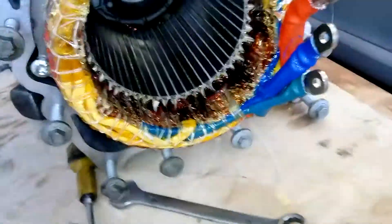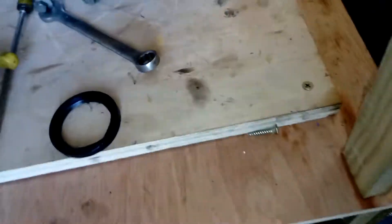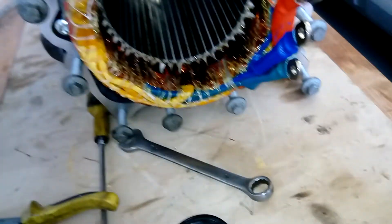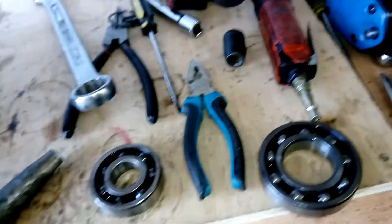This is an oil sealing ring, which might need replacing now because it looks like it's got crushed a bit there. We might be able to get one of them. These are standard bearings — I think they're called 608s or something, just different sizes. It's all clean in there; I'll give it a once-over, give it a clean-out, and then put it back together. But as far as I can see, there's nothing wrong with this motor.